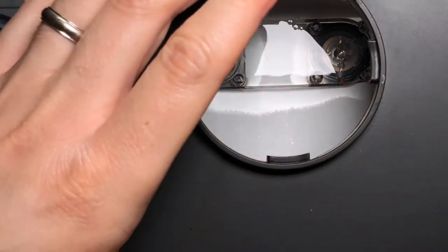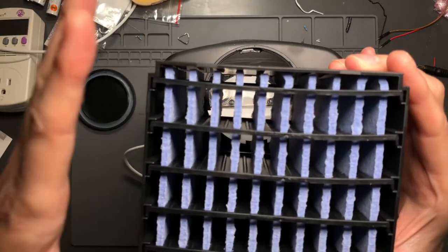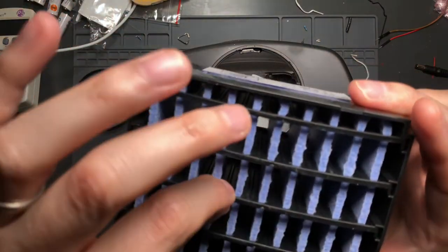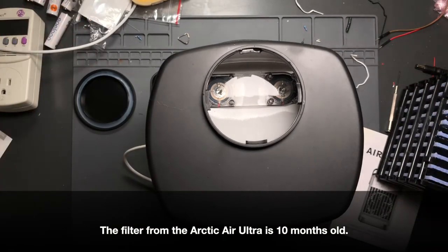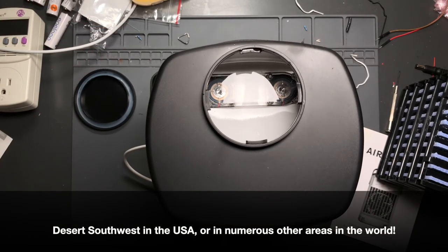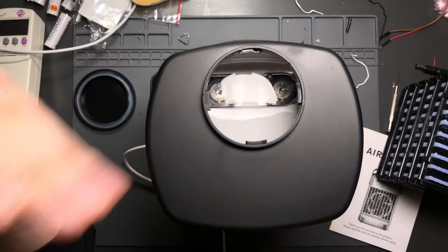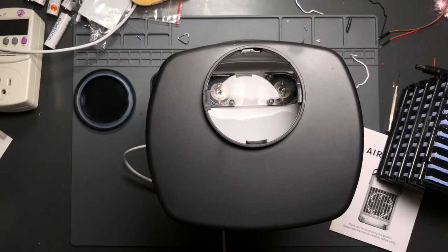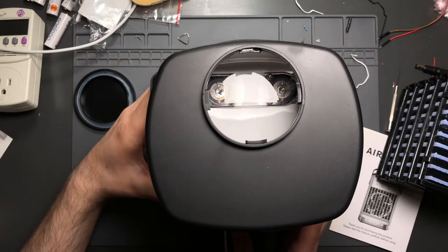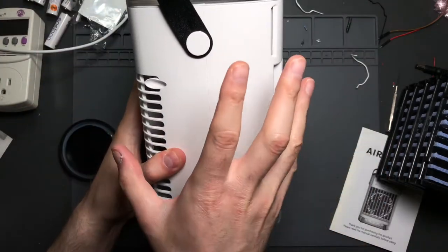Here's where this differs from the Arctic Air Ultra style of filter. That filter you can soak under a faucet, freeze, wash, and clean — and it lasts three to six months. This unit doesn't have that filter. Instead, it's more in line with a residential evaporative cooling system like you'd have in the desert southwest. It has two misters acting both as a pump and as a means to aerosolize water. The water that doesn't immediately aerosolize clings to the inside of a filter, and the fan blows air through the depth of the chamber and out the front.